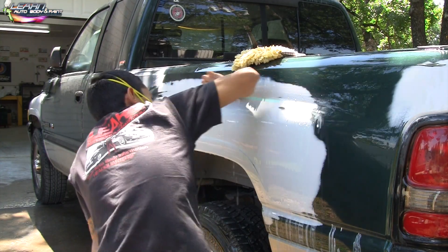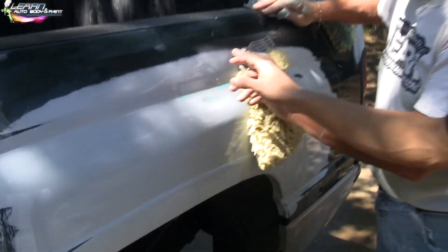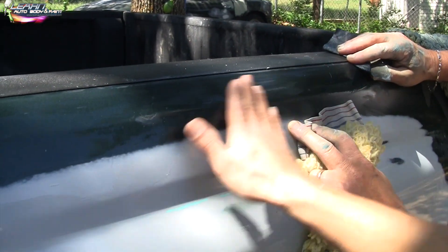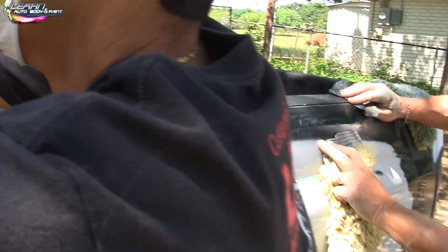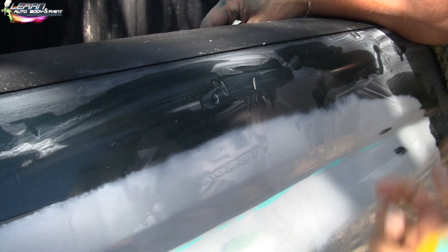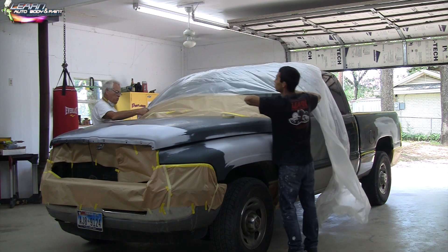You can see I'm washing everything down with 400 grit, getting it ready for paint. Say everything is done and ready for paint but you find a chip or a gouge you missed — it's not too late. Make sure the area is dry, then use something called spot putty — a polyester spot putty. Put it on there, let it dry, block sand it out. Right here I'm using the Warwick 980 spray gun — you can check that out at learnautobodyandpaint.com/shop.